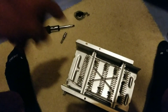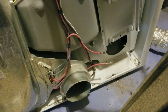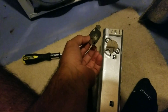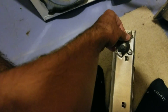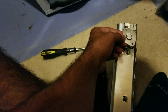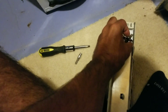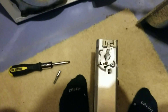I'll just plug the wires back in — mine only had two wires. One went on the thermostat and the other went on to the heating element. The thermostat has a hole on one side and a wire connector on the other side. It basically goes on like this and then onto that connector right there.